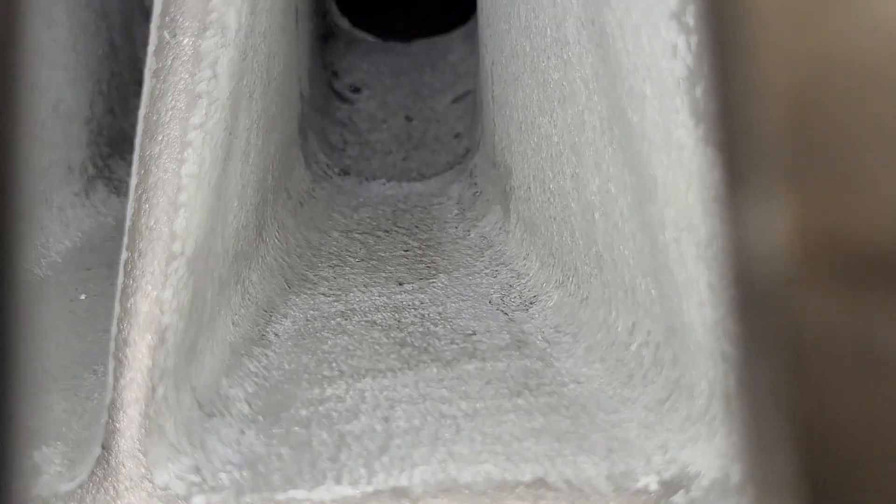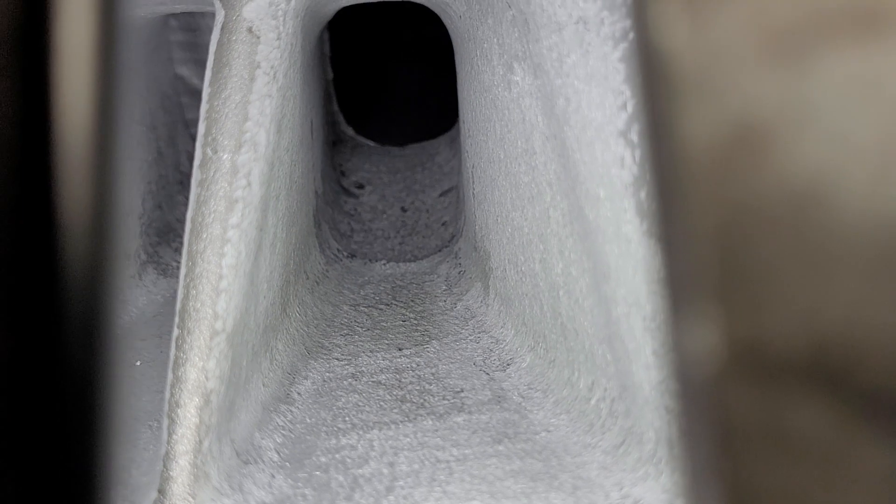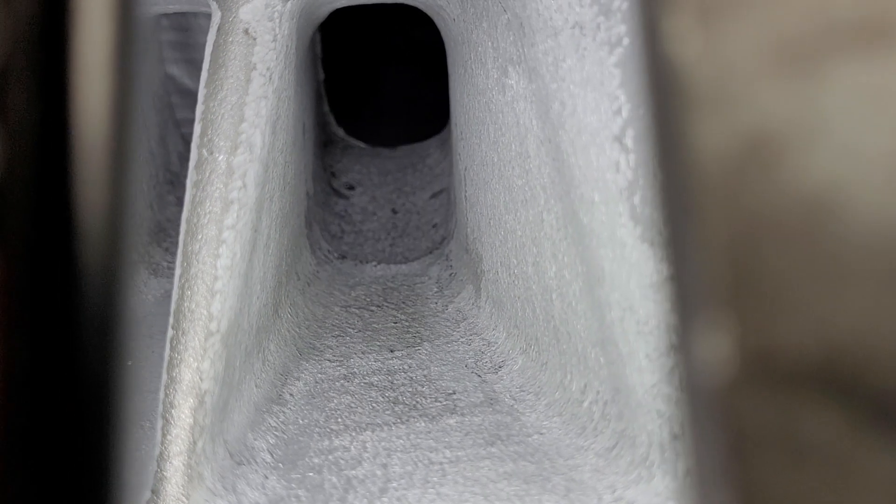And it's not something I haven't thought of, but it is really good to check your airspeed down the runner. If the taper is correct, what should happen to the airspeed all the way down the runner?